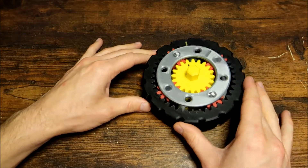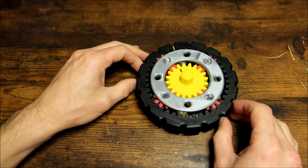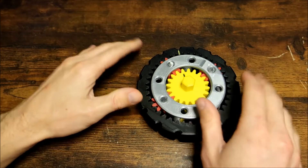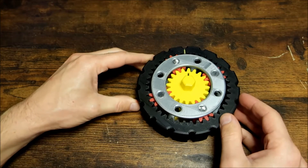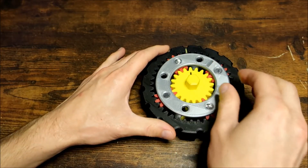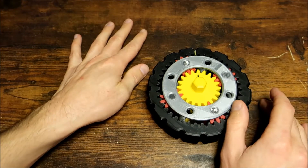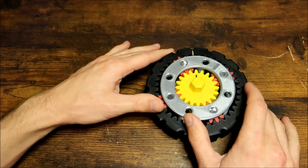There are very creative ways that they actually tie one planetary gear set into another one. There are more complex versions like a Ravigneaux gear set paired with this, which forms what's known as a Lepelletier gear train that they often use on higher gear count transmissions. But we're not going to talk about that — we're just going to look at the simple portion of this. What we want to examine is what actually happens when we hold a component and drive a component — how does power transfer occur, and how are we getting these different gear ratios?